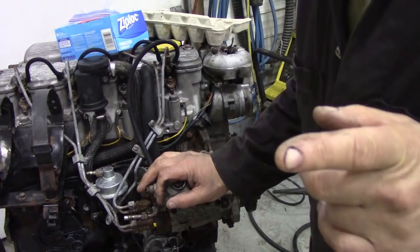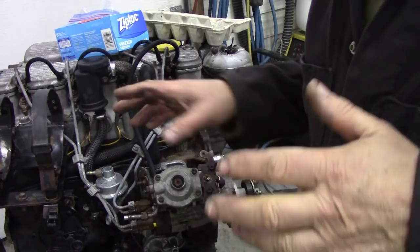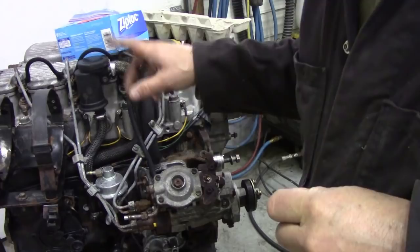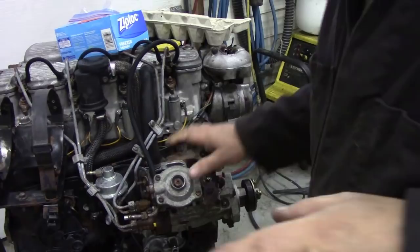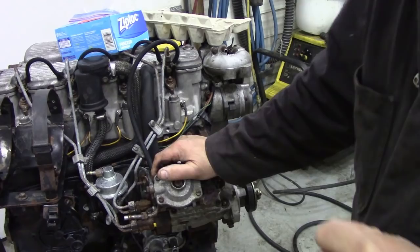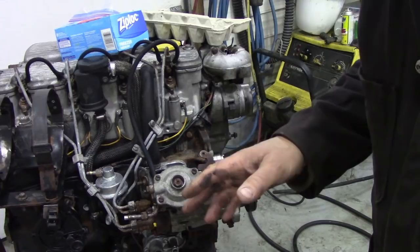Two things. First of all, you know where the bolt is and you know it's a specific bolt for that job. The second thing, which is really important, it stops any dirt, debris, oil, water getting back into that hole. So it does two purposes and it does work. And like I say, there's an awful lot of bolts on here that look the same but are not quite the same. So there's something to look forward to. So like I say, we're going to get onto that. What do we put our nuts and bolts in that we can't put back in the holes, for example?